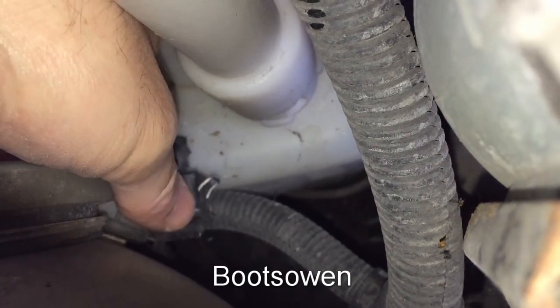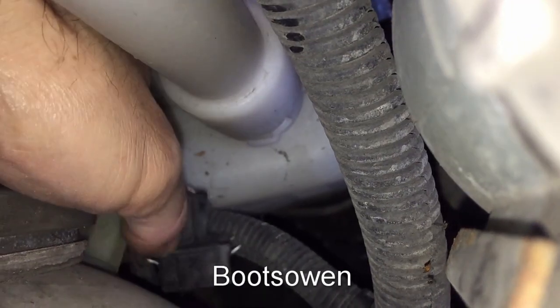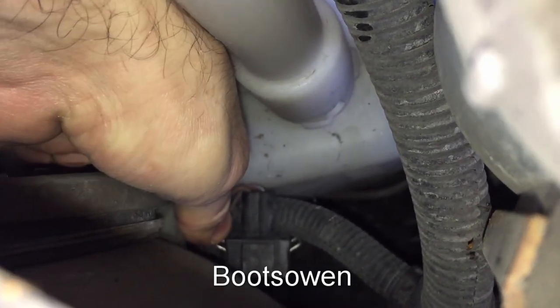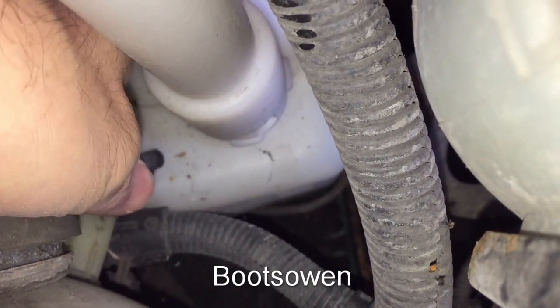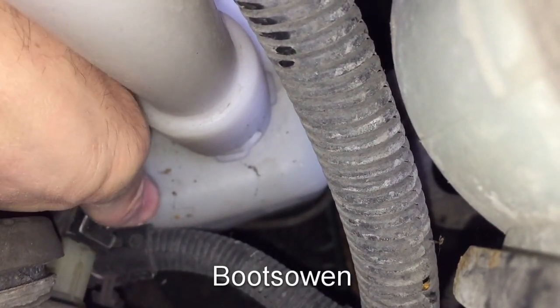And then in here, upside down, the lamp into the slot. It only seems to go one way, and then give it a twist through about 45 degrees or 30 degrees, something like that, and then the holder, the cable clip, just snaps on top. And at that point we should be able to see if we've got light coming through the bulb. Just snaps on there.